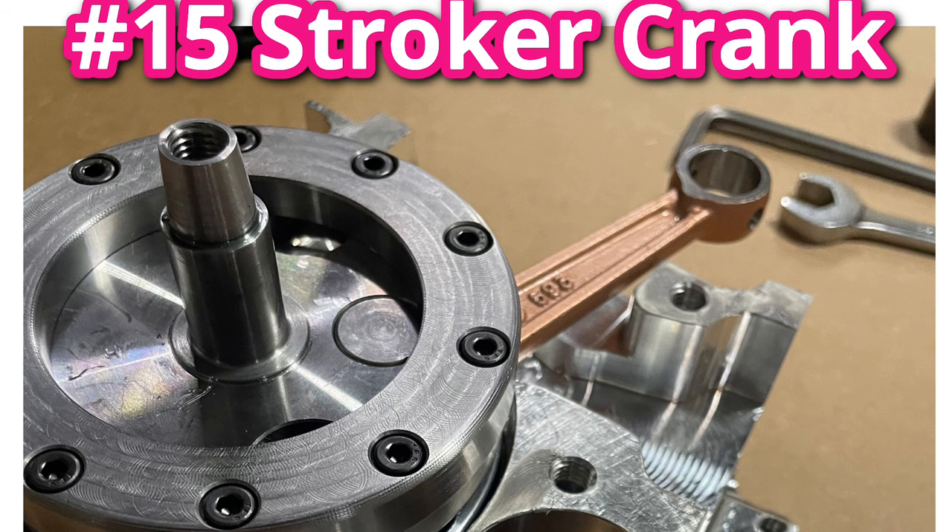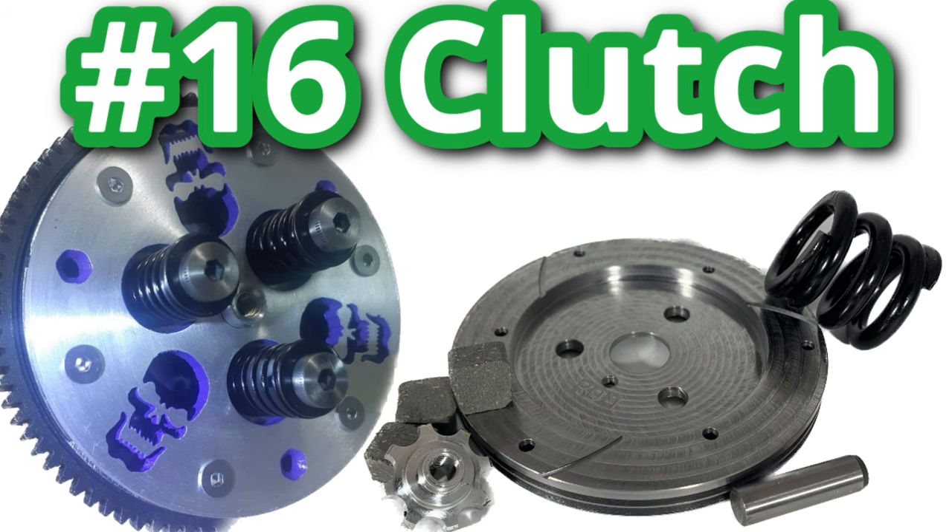Last on the list: stroker cranks. With any engine, increasing the bore width and the stroke length is a recipe for maximum power. If you have undergone a hybrid swap, you have already gotten your bore taken care of. For more torque and power, get yourself a longer stroked crank. If done correctly, this mod increases performance and torque by a large margin. To handle all this power, you'll need an upgraded clutch. There are two primary clutches on the market: the HD clutch sold by RDM, and the SAF clutch sold by DLH Performance. The SAF clutch performs a bit better than the HD clutch from my experience, though the HD clutch is a bit cheaper. I highly recommend spending the little extra and getting the SAF clutch.